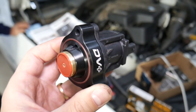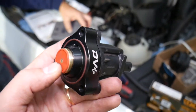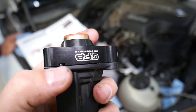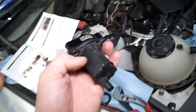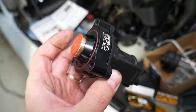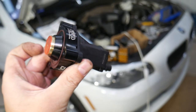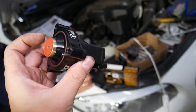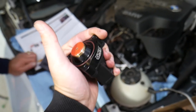This is it guys — you can see the DV Plus and how we put it together. Make sure everything is clean. It goes only one way on most cars, so make sure which way you removed it. You can see right here where we have that notch — it goes in the corner, so you need to install it at a specific angle. We'll also have a video on how the DV Plus diverter sounds on a BMW — check it out on the channel. Hopefully this video was helpful. If you have any questions, let us know. Thanks for watching and see you next time!